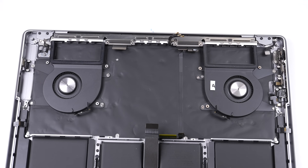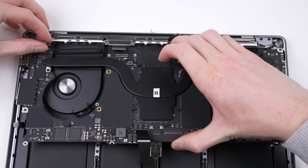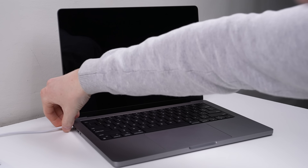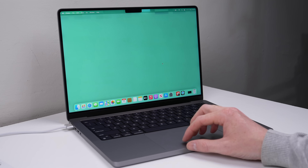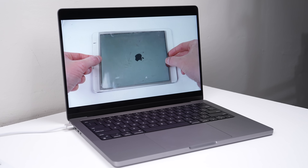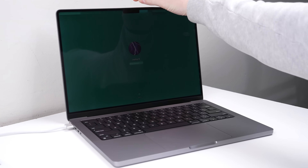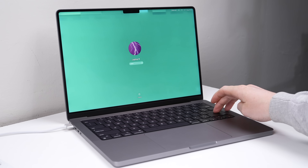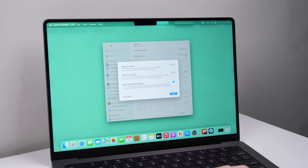I'll remove the logic board from the other MacBook Pro so we can swap across to a different board to see what happens when everything inside the computer has suddenly changed — that includes the display, battery, ports, and even the Wi-Fi antenna. We get our glitchy screen back along with the other issues we had when we replaced the display, but this time I've lost my fingerprints and it won't let me add any new ones, saying it's unable to complete the Touch ID enrollment. But the sleep function works, confirming the sleep sensor isn't paired to the logic board but the screen. The screen, however, is paired to the logic board, which is why we're getting those issues with the display's image and backlight. I was surprised to see battery health still working.